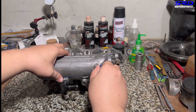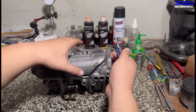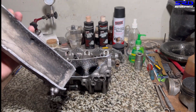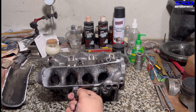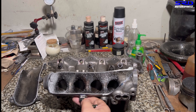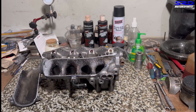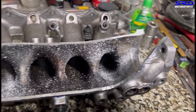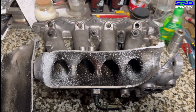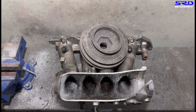Let's open it up and show you guys. The stock intake manifold is unported. It's going to be a bit dirty because there's carbon buildup, and some debris because we actually sawed this off. Now we're going to try to open up the runner entry — this one is going to be mimicking a velocity stack to gain airspeed. Now we'll go to the porting bench.